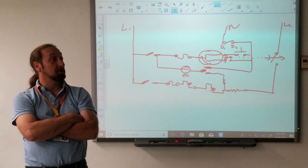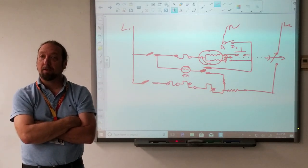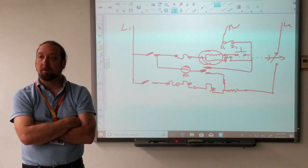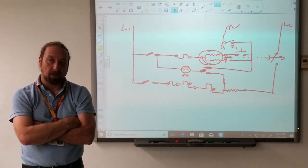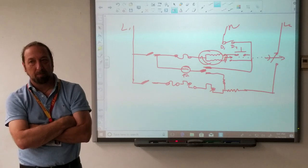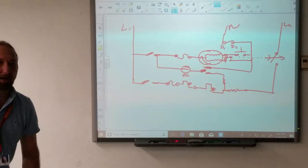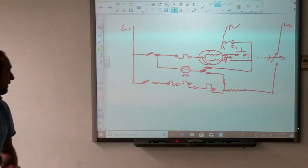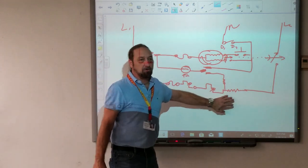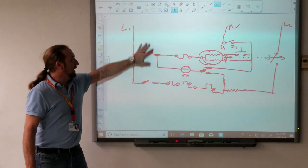A lot of people say it's not in series with the motor, but that doesn't make sense. It's not directly in series because the timer motor controls the timer, which activates that motor at specific times through the cycle. That timer motor doesn't activate the drive motor. You see all this stuff — thermostats, heaters, centrifugal switches, door switches, timer motors, timer switches.